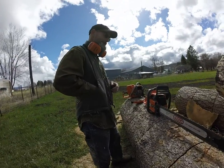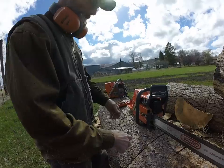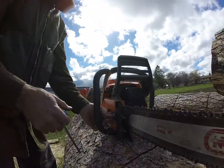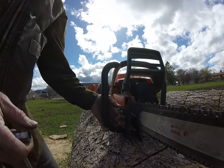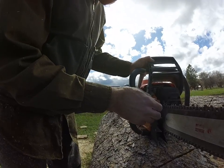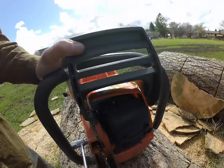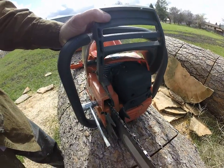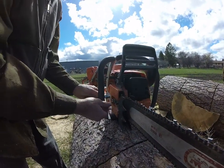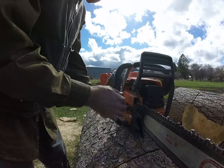Come in a little closer. Alright, so like I said earlier, we're testing the 390 with the modified combustion chamber. Keep in mind that both these saws are fresh out of the shop, so we're still getting the carburation dialed in. Take a look at the screen. Anyway, they're still running pretty dark — you can hear when I was backing off of it, how it's blubbering at high idle, which is good for the break-in period.